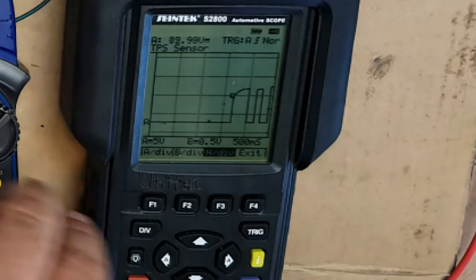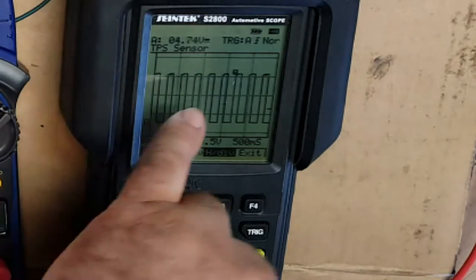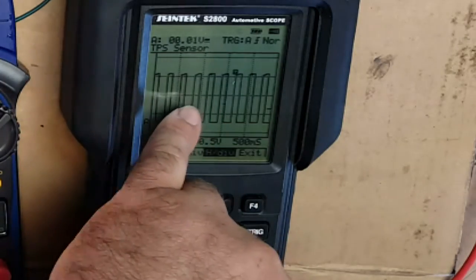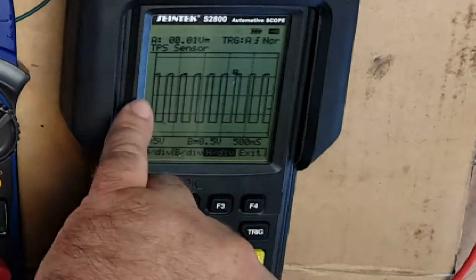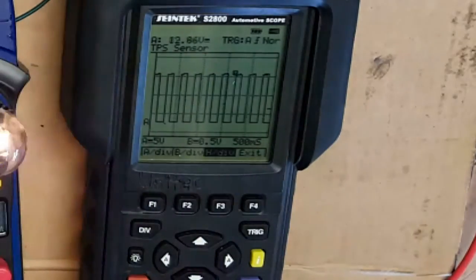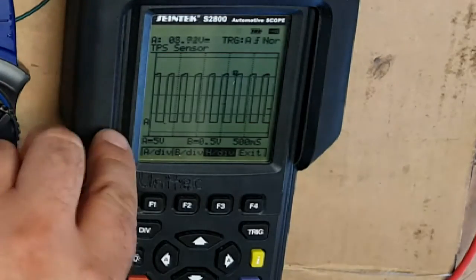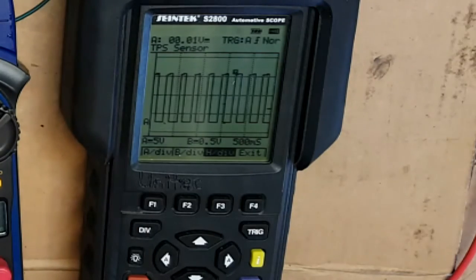If we have a look at that, once it samples enough, there you go, we've got essentially 2 actuations per half second. So we've got 4 per second, which means we're running around about 4 hertz. If that was the indicator on your car here in New Zealand, that would be a warrant fail. We're only allowed to have actuations of between 1 and 2 hertz for your indicators.